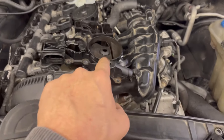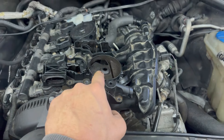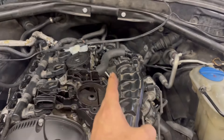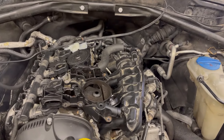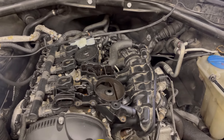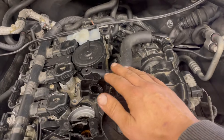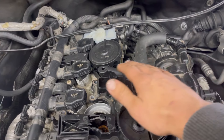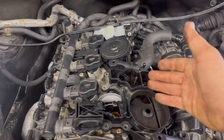This main valve with the diaphragm is constantly working between naturally aspirated and boost — non-turbo and turbo. Your boost comes on probably around a little after 2500 RPM. Anything before that, we're sucking our hydrocarbons and blow-by gases into the intake and then carboning up our valves.